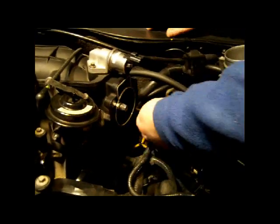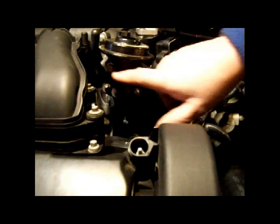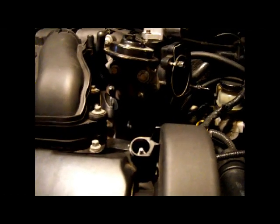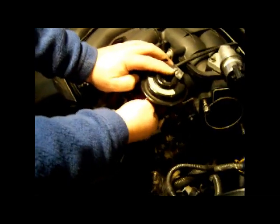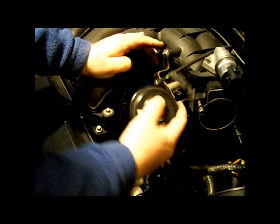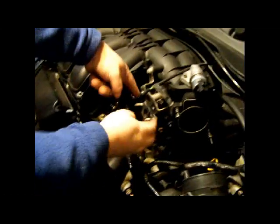Now the next thing is to disconnect the EGR. Underneath here, if you look down, you'll see there are actually four different bolts we have to disconnect to get this apart. There are two bolts at the top of the EGR, and at the bottom there are two nuts on studs that fit the pipe coming up from the exhaust. Then the EGR comes off. There are two gaskets that should be there — yours may be corroded depending on how old they are, and you may want to have a new set of gaskets ready. But now we've got that apart.